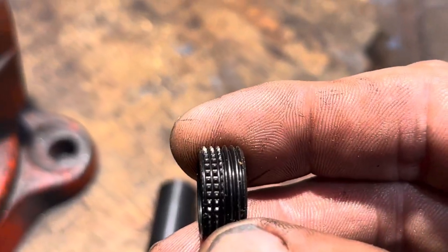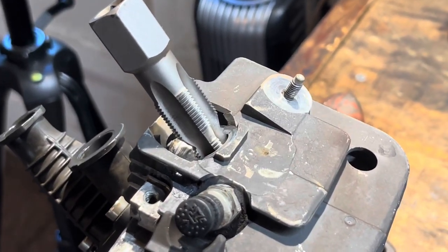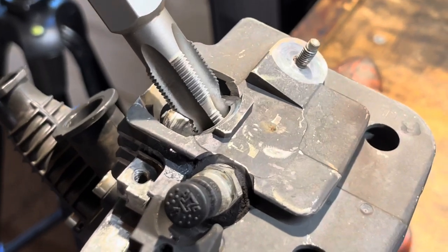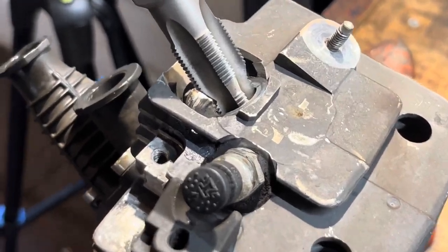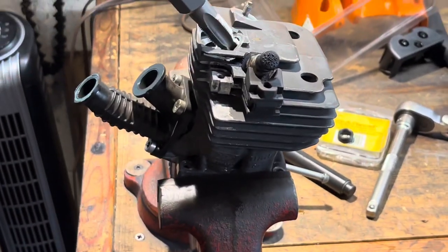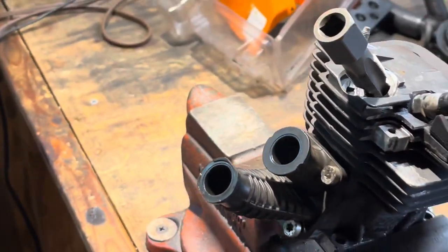Once you get it seated, a couple of swift taps with the hammer will spread the top and plant those grippy feet into the threads. I don't recommend using any Loctite on these - most Loctites are rated up to 450-500 degrees, and I'm pretty sure your combustion chamber is pushing close to that, so it may not be worth it. I've done dozens of these and only had two failures, and those were because I didn't install it properly. It's a good kit - the tap, punch, and a few inserts was like 40 bucks, probably 50 now.